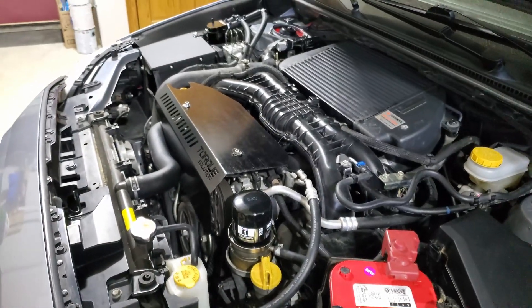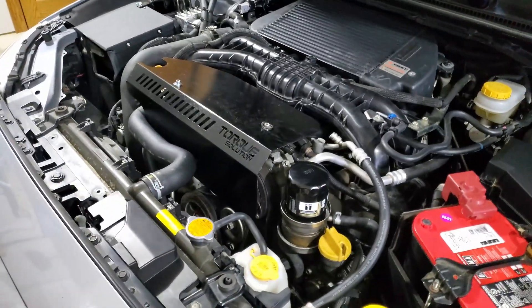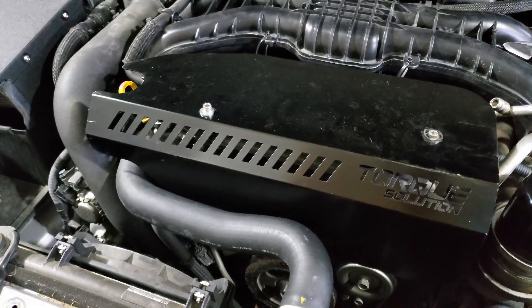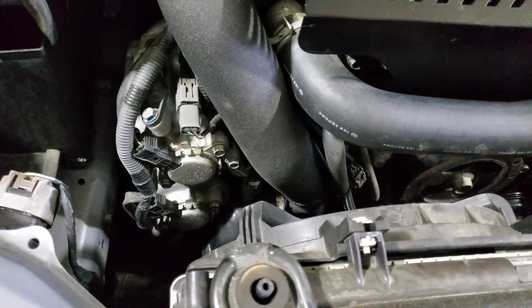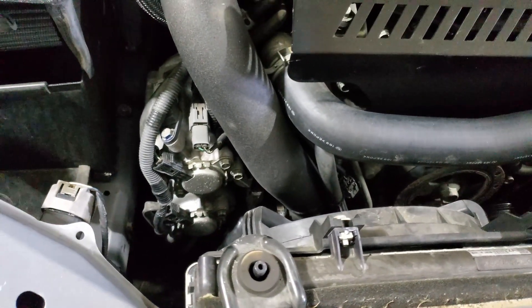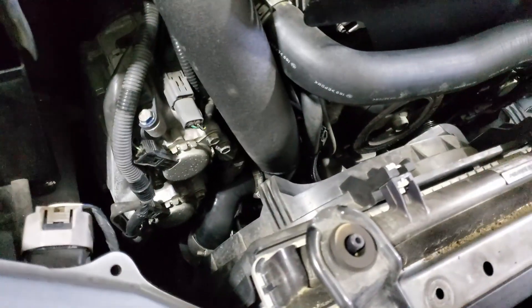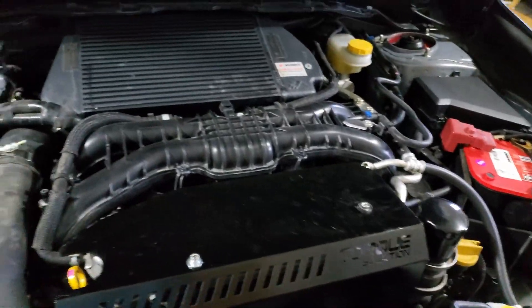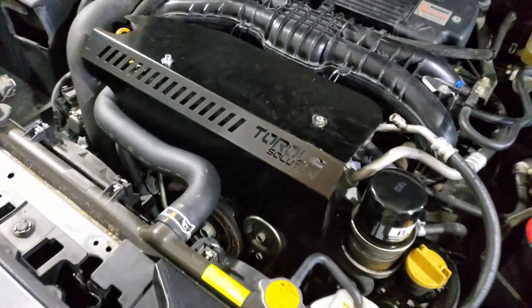I did see an interesting video last night — the guy had some trouble at idle but was at least able to idle, though it was really rough. He sprayed little bits of brake cleaner on where his hoses were connected, and the car would act differently. When he got to what looked like his bypass valve, the hose was disconnected — that's how he found it. So I'll try to get the car running and shoot some stuff here and there to see if that helps, but I want to do more visual inspection first. I'm going to get this engine cover off.